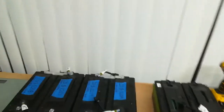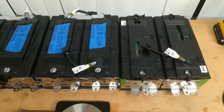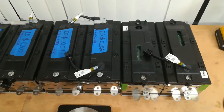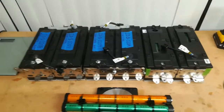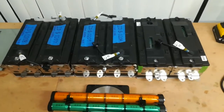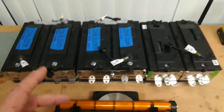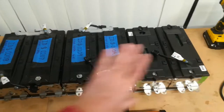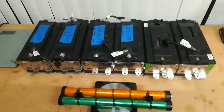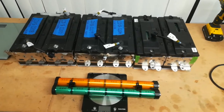You can see the relative size there. Initially with two blocks together, I'm just going to sit them on a tray in the boot, basically above the IPU compartment. If it all works out, then we - or others - can start thinking about getting serious about mounting them properly in the IPU and recovering your boot space. It's quite a neat construction; you could easily put these on a tray fixed down to the chassis and cover them with a nice plastic or light ply cover. The three battery pack would be the high performance version, looking at 15 to 20 kilowatts without too much trouble.